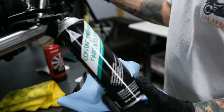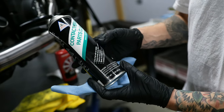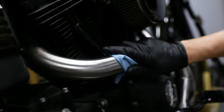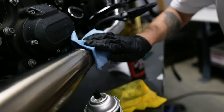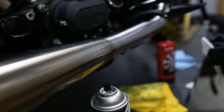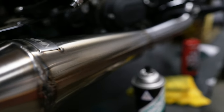Something I also like to do as soon as I'm done is remove any finger oils and polish residue. Use a brake parts cleaner — something that leaves no residue, dries quick, and is safe on metals. Spray it on the rag, get the rag wet, and then go over the exhaust. You can see it drying up real quick, getting all of the oils and finger oils and polish off of it. This pipe will actually go back to gold. I didn't do the muffler as much because it didn't have as much wear — I ran the white pad lightly just to shine it up following the grain, but it didn't need it as much. Those marks will no longer be on the system.